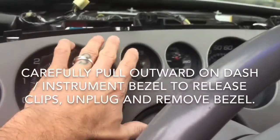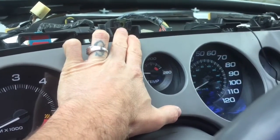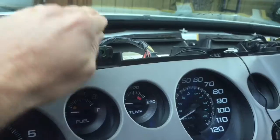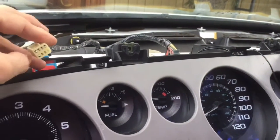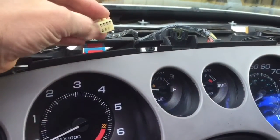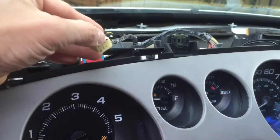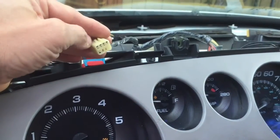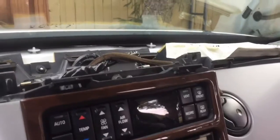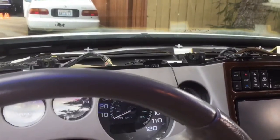After having all the previous panels removed, and after you have removed these five long screws, you'll want to lift up on the dash slightly. Pull out and lift up just a little bit, and it'll create enough space for you to unplug this one wiring harness. This goes to the bezel and some of the dash lights, and possibly a car alarm if you have one. Pull out on the tab just a little bit and separate the two. Be careful not to break it. Then pull it out, wiggling each side just a little bit to work its way out.